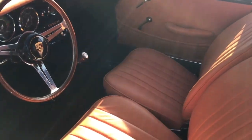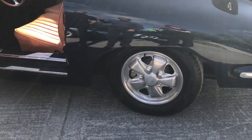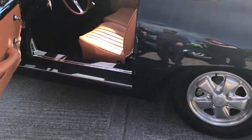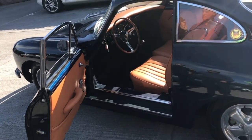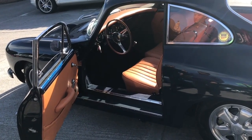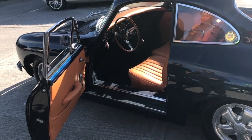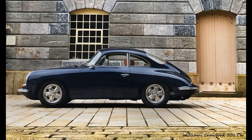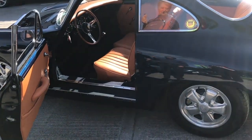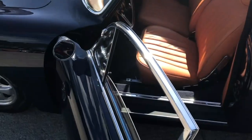It's coming out stunning — it modernizes the car and brings it all together really nicely. On the suspension, it's pretty much stock with Koni shocks tweaked up a little bit. The brakes were refurbished with new refurb calipers. It's a pretty stock ride — a little bit firmer, but it performs, stops, and handles as it should. This one was fitted with discs on all four wheels from the factory, so it's a factory brake setup.